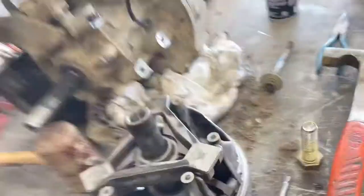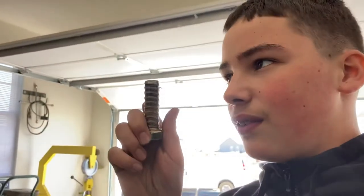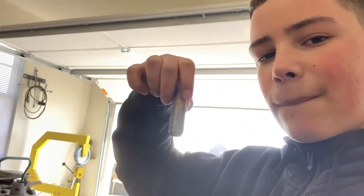That is the quarter-inch extension right there - you guys can see it all smashed up. So basically we're going to tell you it does work, because these clutches are a pain and they are on there very good. I could tell it was probably intentionally put on there very tight because there is not a single keyway on the shaft. So you want to get a three-eighths drive and a three-quarter, two-and-a-half-inch fine thread bolt.